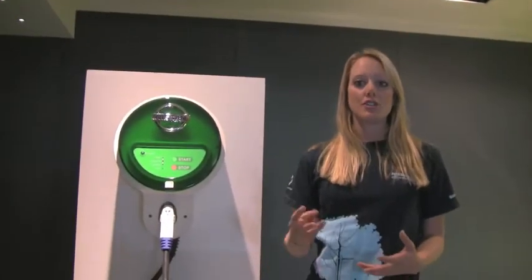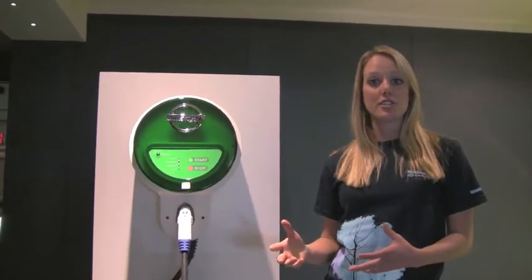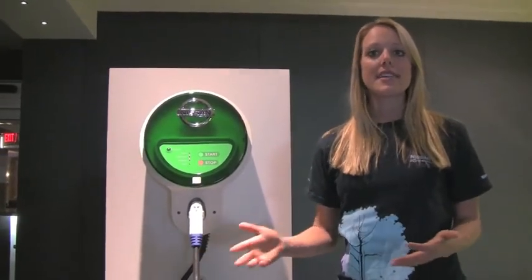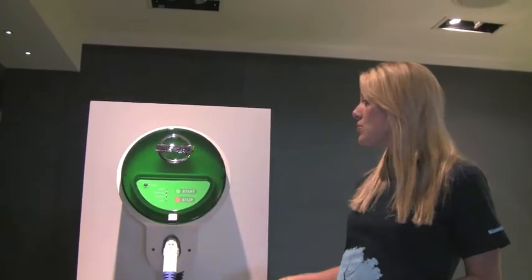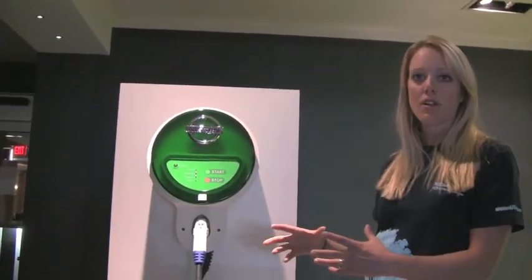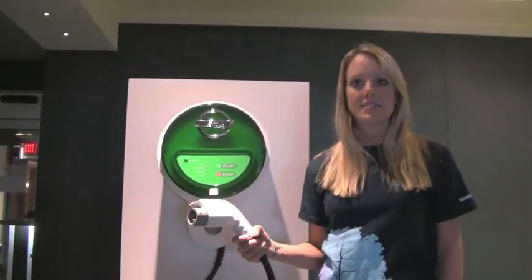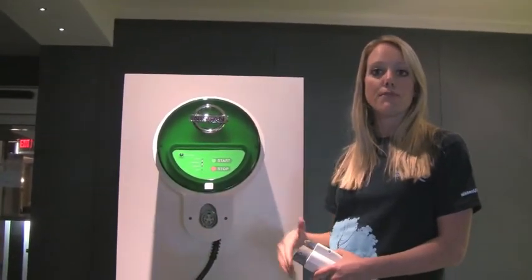To charge the car you have three options. One is just a standard 110 outlet — it comes with a courtesy plug for charging in any wall outlet. The only issue with that is it takes the longest: 16 hours to get a full charge at 110, so in eight hours overnight you would only get 50% charged. Then you will also have a home charging kit like what we see here. This is called an EVSE. It comes with the J1772, which is that EV plug that's being standardized. It's a 220 volt hardwired circuit, and this is what charges your car in four to eight hours.